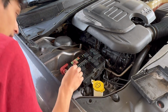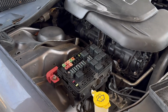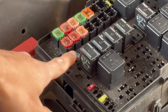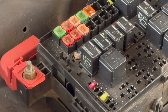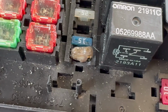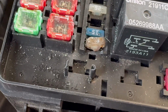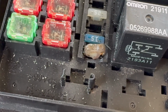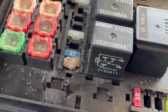Okay. So that would be right. Oh wow, check this out. I don't know if you can see, but the fuel pump fuse is right here. This one right there. Let me show you how bad it looks. Pull that fuse out. It's so melted. Oh wow, we gotta replace that fuse. That fuse is really bad, so we're gonna have to change that fuse out before it causes us problems. So we're gonna change that. But that's the fuse we're gonna remove in order to release fuel pressure.